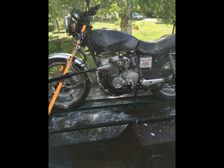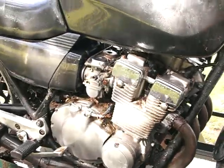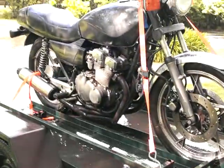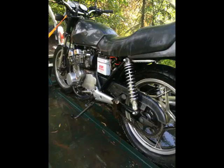Has about 70 horsepower, so it's plenty of horsepower. I'm going to have to put some sort of jack shaft in it and change the gearing, because otherwise, from some calcs I've done, it looks like the mower will end up doing about 120 k's an hour, which is obviously a bit too fast. But having said that, whatever happens, it's going to be pretty unique and a lot of fun.